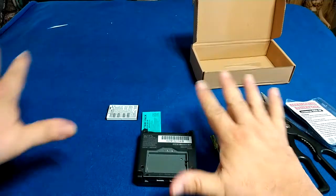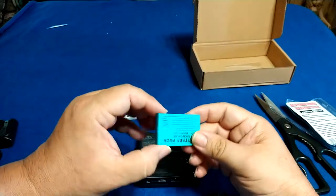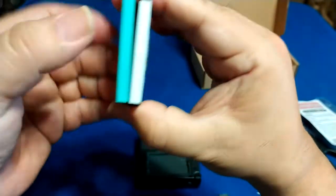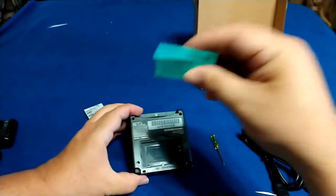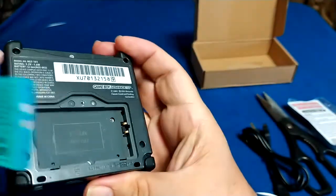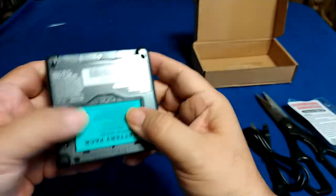I should really invest in one of those iFixit magnetic trays — that'd be a good idea. So this is the old battery right here, and this is the new battery. The terminals line up perfectly, which is great. They are the exact same size. You can see how the old battery rocks — it's bulged. So it looks like I won't have any trouble fitting the new one in. You open the cap, the positive terminals and terminal contacts are right there, you slide the new battery in — just like a typical cell phone battery.